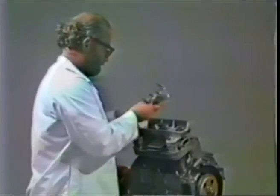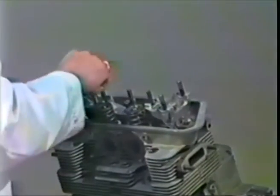Put on the other rocker stand. Again, it only goes on one way. And put the remaining 3 10 millimeter bolts in place. On the 356 normals we use a cast iron stand held only at the outer extremities by a bolt here and a bolt here, and they're 17 millimeter across the flat rather than 15. You can actually use 17s in these two positions, but there's no need to. If you're taking apart the same engine, you should have all the right bolts for it. But if you get some Volkswagen shop that specializes in Porsches, watch out, you can have almost anything in here. Put a 17 millimeter across a flat bolt there, you never get the intake rocker stand in place.